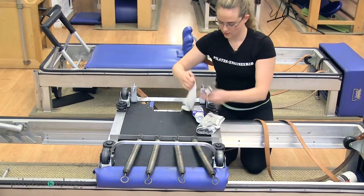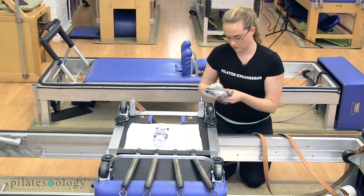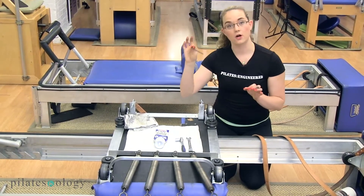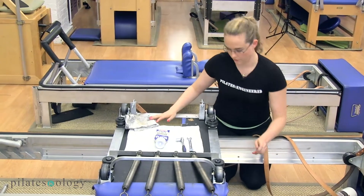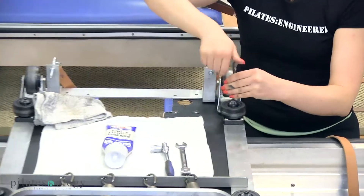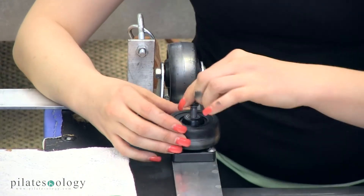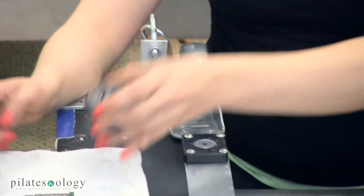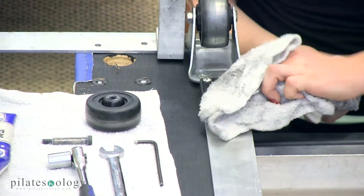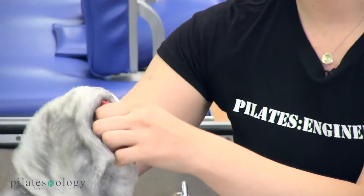What we need here is a drop cloth to keep the carriage clean, white lithium grease, a cleaning rag, a half-inch socket wrench, a half-inch crescent wrench, and our 5/32-inch Allen wrench. You'll use your Allen wrench to take the small wheels off — do the same process for each one. The bolt comes out, the wheel comes off, and you have this metal block. We'll clean the metal block of any grease or dirt or residue, then use the same cleaning rag to clean the bolt and remove any hair or gunk and residue off of it.